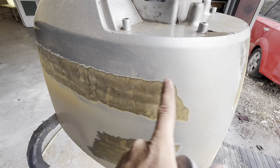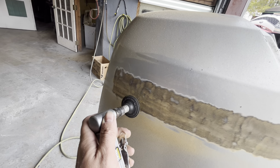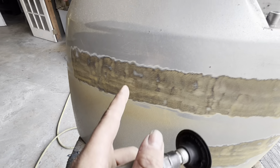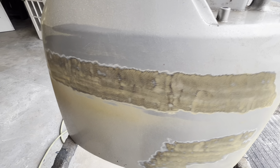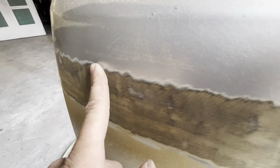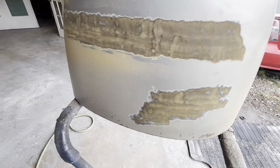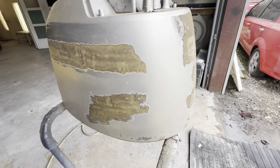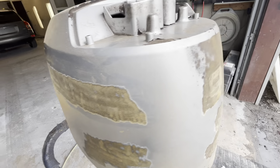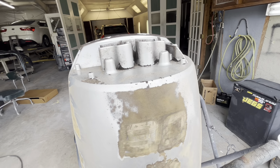If you're riding on top of the vinyl only and not really too much on the paint, it shouldn't eat down into the fiberglass. So that's what I did — just worked it a little at a time, pretty fast, try to stay on top of the vinyl. Of course, as soon as it cuts through the vinyl, you keep it moving and feather out your edge. If you could feel it, it's not really gouged up. I actually like this method a ton. It's really easy — nowhere near as hard as shaking this thing on a stand and scraping it with a razor blade.